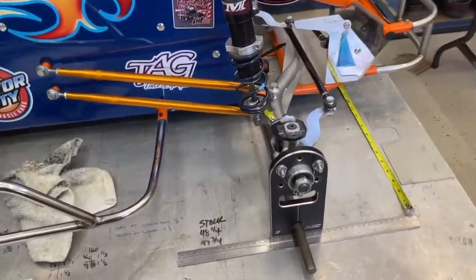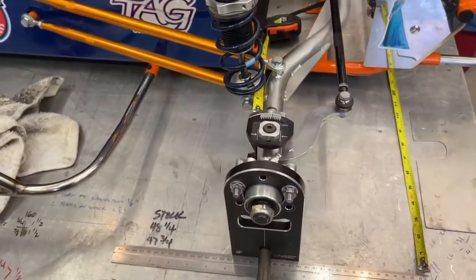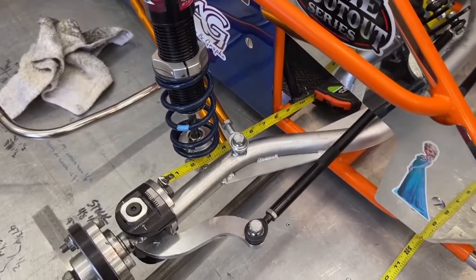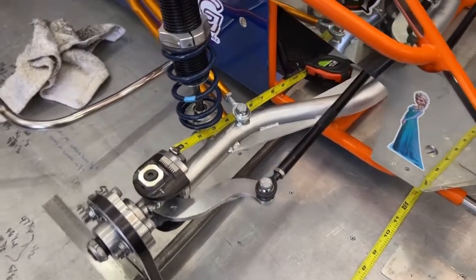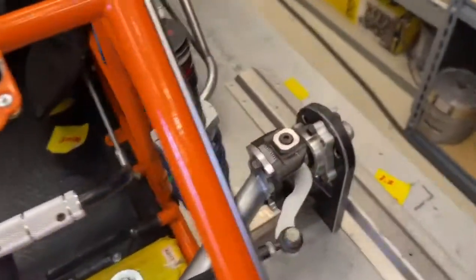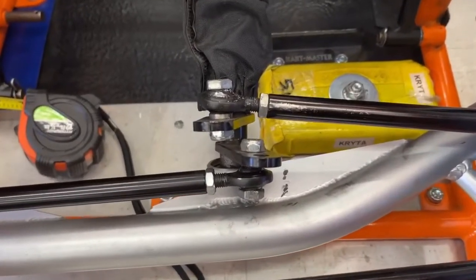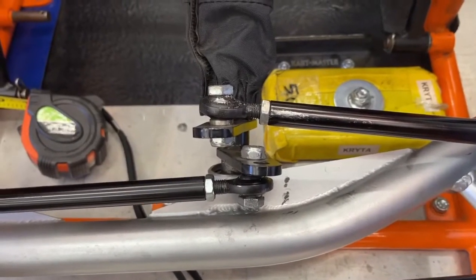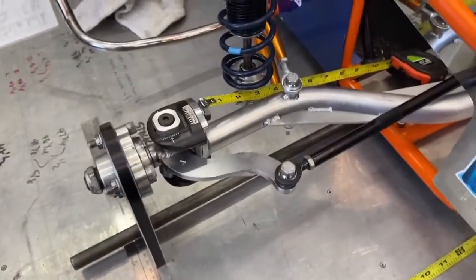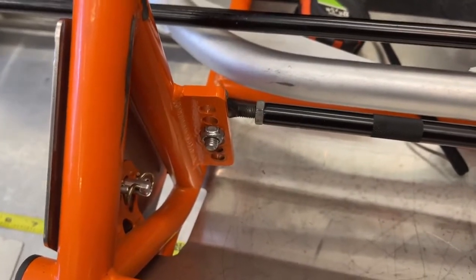We are now working on the front end of the car. As you can see, this is a floating axle. There are two radius rods on this side and another radius rod on the other side. There's a lot going on here because this is a floating axle - the shocks are doing the work and the radius rods are keeping it all in place. The first thing we do is put it on these setup blocks and then put this bar in here. With that bar on both wheels, it's locked the steering. On these Nervo cars, you want the steering column to be exactly between the two nuts and the two plates - that's exactly where we have it. Over here, you can shift the axle to the right and left with the front panhard bar, and right now we have the panhard bar in the center location, which we normally have it.